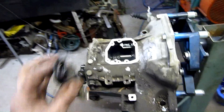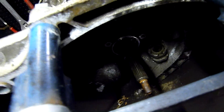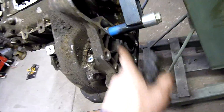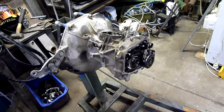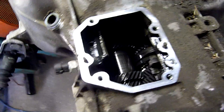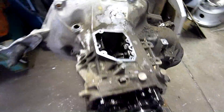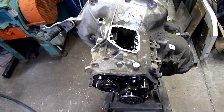It's probably a Hall-type or inductive pickup - good spare part and handy for something. I've taken the main thrust bearing housing off. I'm just breaking down everything I can - I'll take that off, loosen all this, take the reverse switch out. Then I've got to remove these clips and start removing the back end so I can pull all this out. I might actually be able to pull the whole gear set out as one unit - if I leave all the cap screws intact I should be able to draw the entire gear set out as one unit, because there's really nothing to hold it in.